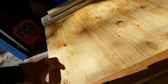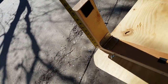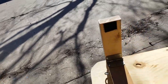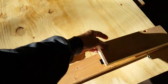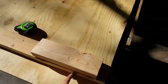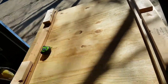These are the furthest back legs. There are going to be three pairs of legs. I've got them Velcroed down so they're easier to install. These legs in the very back by the hatch are cut to be 10 and a half inches long, and they are attached with door hinges — the satin nickel ones so they wouldn't rust. They fold down to a piece of Velcro to hold them in place while we're sliding it into the doorway. I attached eyelets so that I could bungee cord it down to the anchor points inside the back of the RAV4.